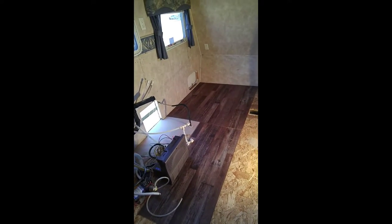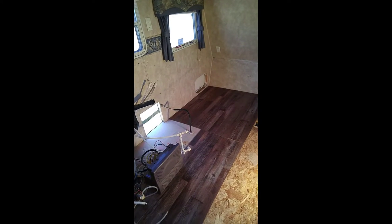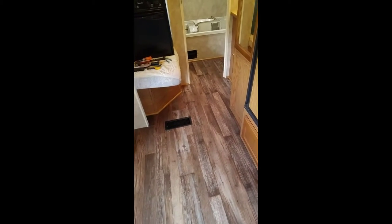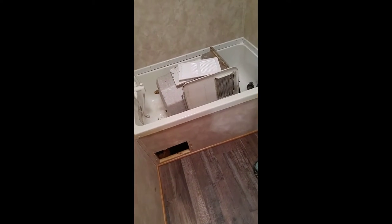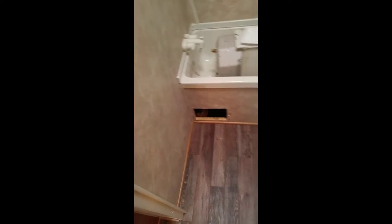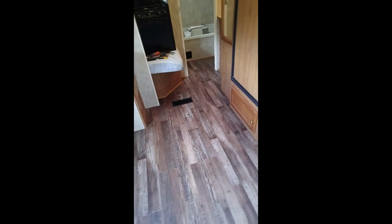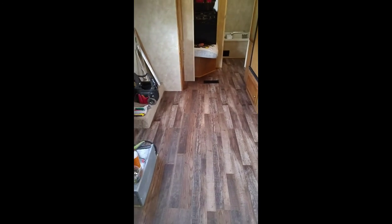I completed it — stopped to take out the video — and it turned out pretty damn good, I gotta say. I put the new floor registers in and here's a good shot of the whole floor. I also put some molding in — you can see around the base of the bed I put corner molding. In the bathroom, that panel piece in the back that I uncovered looks a lot better now. The glue works really well as long as you leave it to dry about 15 minutes before you apply the tiles, then use a 100-pound roller to roll out the air bubbles. That's it for now — stay tuned for part 7, remember to like and subscribe, thank you, bye!